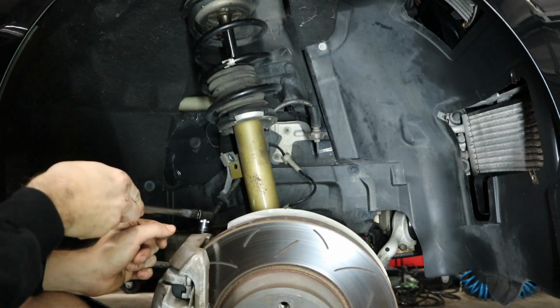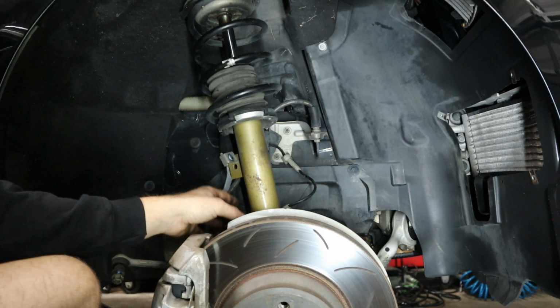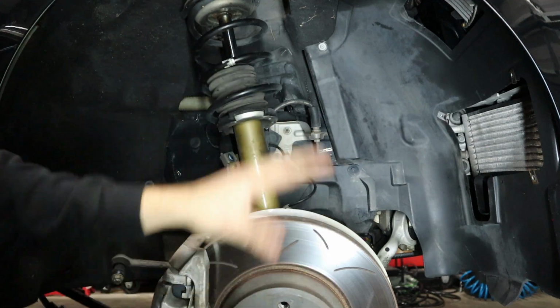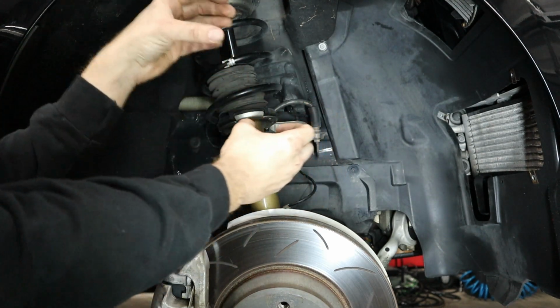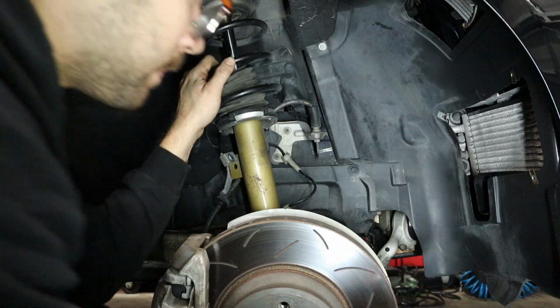This other bushing here is actually an E90 M3 control arm, so it doesn't have any preload for the rear control arm bushing right here, but we're gonna loosen that one, should get this to drop low enough. And then when we reinstall the new stuff, we need to remember to load up the suspension and then tighten down the bolt so that the bushing is preloaded in the front there. So let's go ahead, loosen this up.